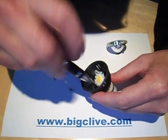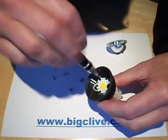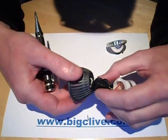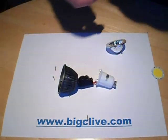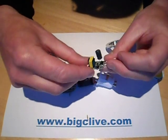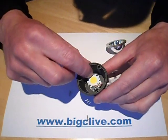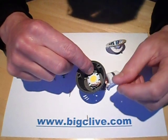Three screws come out here. I kind of know what's in here already because it's going to be very similar to the other universal voltage ones — it's going to be one of those little switching power supplies, all sleeved up again, nice and tight, quite thick sleeving. It takes the mains in through a rectifier, a control chip, a little transformer, and basically puts out current-limited or power-limited power to the LED, so the LED runs at a specific power.